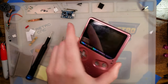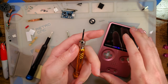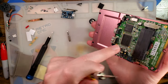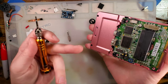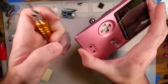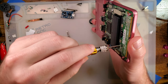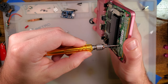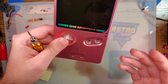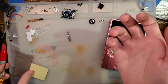Not everyone understands exactly how tight the screw is supposed to be, especially when going to metal from plastic — it's just not intuitive. Sometimes just try it out, see how the buttons feel, put it together, and if it's too tight and things aren't working, try coming back, backing the screw off an eighth of a turn, put it back together, and try it again. In a lot of cases, you'll find that that cleans up a lot of issues with button feel.